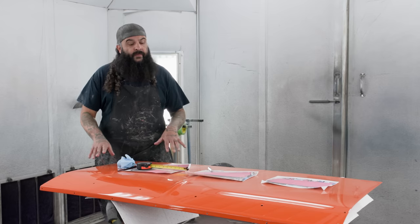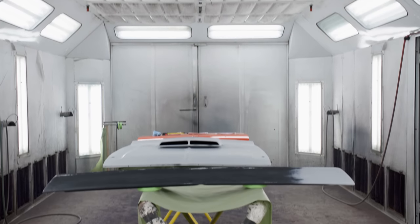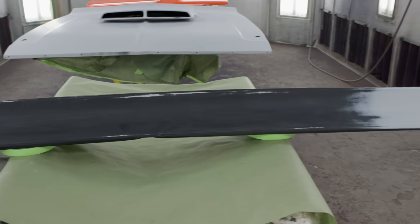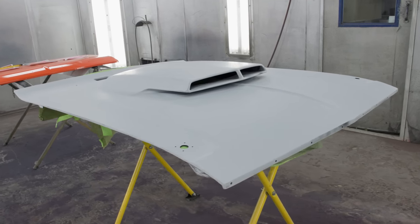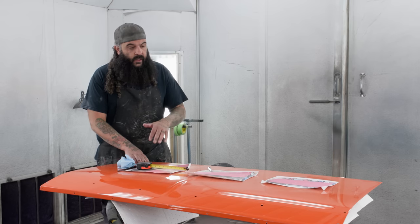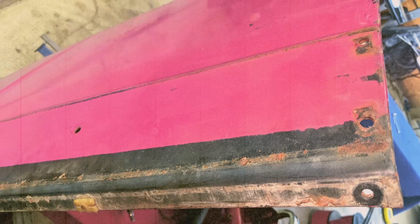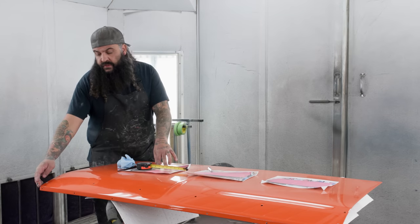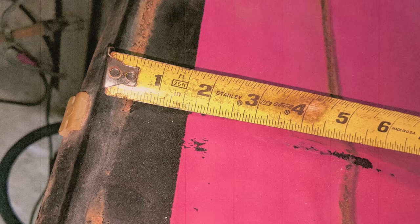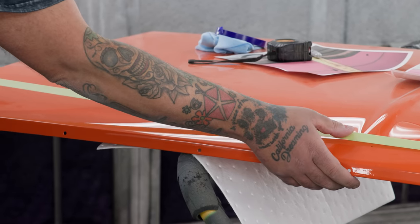Today's an exciting day because this is the last paintwork we have to do on our SEMA build for this year. It entails painting the spoiler flat black, the hood flat black, and the deck lid. Tony was nice enough to send us references of an original Panther Pink TA that he had pictures of. We'll measure the same measurements — about an inch and five-eighths from the end of the deck lid — mask it off, and start the flat black process. Then we'll kick it over to assembly to finish putting the car together.